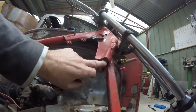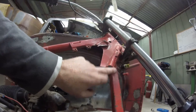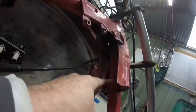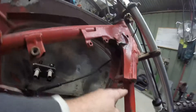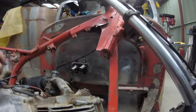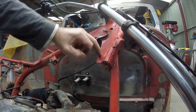This was the modification for the frame - you can see it better with everything off. We chopped the tubes off here; we didn't want to take it right back because once we start removing from here we start cutting into this gusset and weakening it. So we used a bit of 25mm square tubing. We were lucky there was a cross brace in here already, so it worked out good. We put some gussets in here to box it in each side to give it strength on the front, and then welded it to that crossbar. It's nice and solid and goes all the way up to the top of the frame.